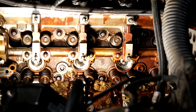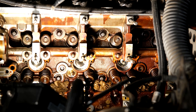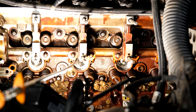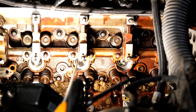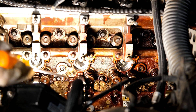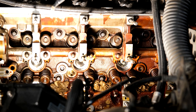I'm going to crank the engine now until that piston gets to the bottom so that the valve can fall in all the way. I've put the spring in here to show me that the piston is at the bottom, so that valve would actually fall in. Let's check - almost there. If you listen you'll actually hear it fall in. It's fallen in the cylinder - now look at that. Now what do you do?